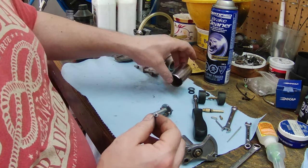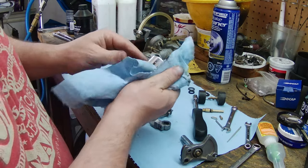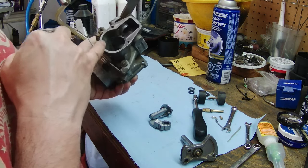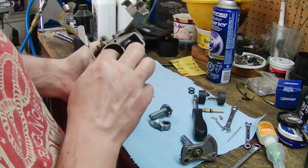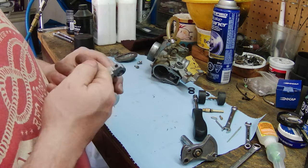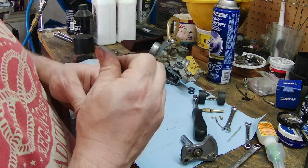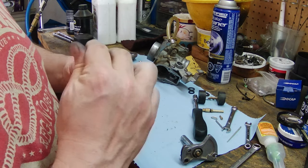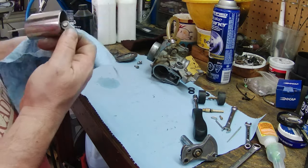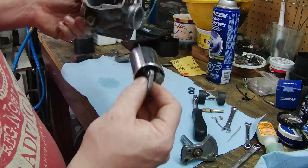It's always a good idea to work on a surface where there's not a bunch of crap underneath you because you're always going to drop stuff. The slide goes back into the carb body - it's keyed only one way. There's a little protrusion that only goes one way and that has to go to the rear. Not running a stock air box and not having a stock muffler, I really should be running richer than stock. So 27.5 for a pilot jet - it just doesn't seem like it should be that far off. Maybe that new air box design is just so close to the original.